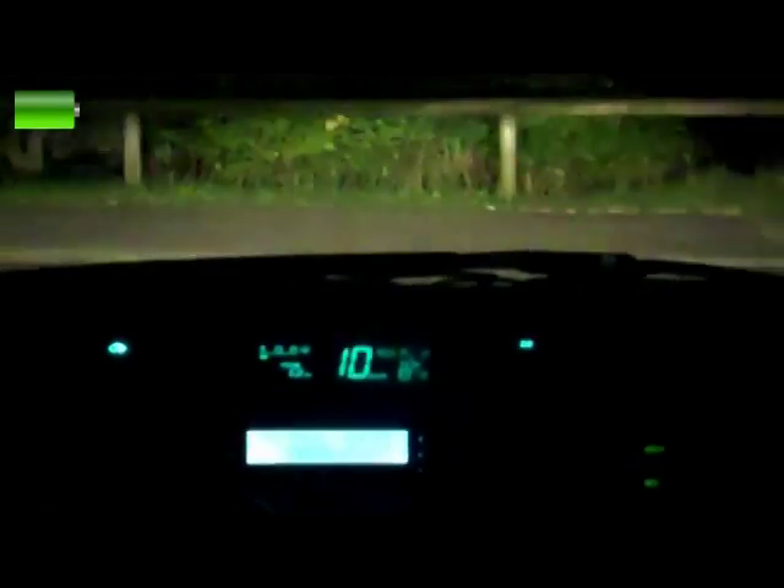On the left side of the dashboard there's a blue icon — that's the EV mode, the electric vehicle mode. This mode is standard in the European Prius; you just press the button and, if the traction battery has enough power, it will stay in electric mode. Normally a Prius will kick you out of this mode after a few minutes due to insufficient power, but in the plug-in conversion, extra power keeps the hybrid battery charged so you can keep driving.